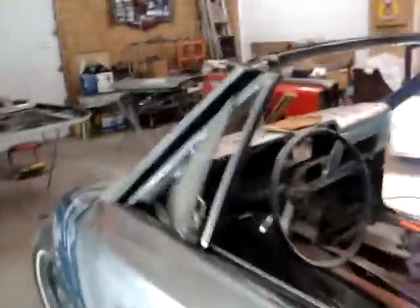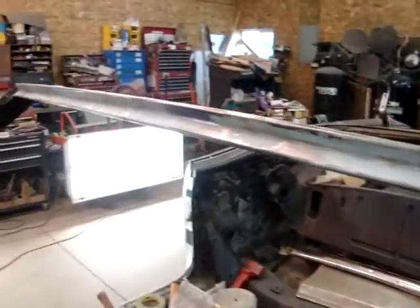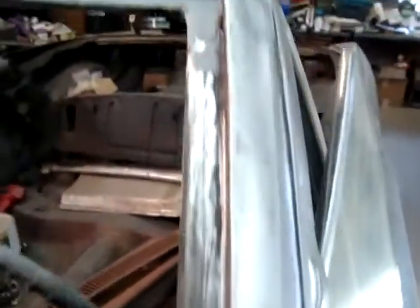Windshield frame on this car, all the moldings off around it, was not good. Again, I did not video some of this work. There was rot out all around this windshield track. It's now been repaired. We've got the Duraglass over top of all the repairs now. We'll knock that down and try to get a nice flat edge for this windshield to lay back down against.